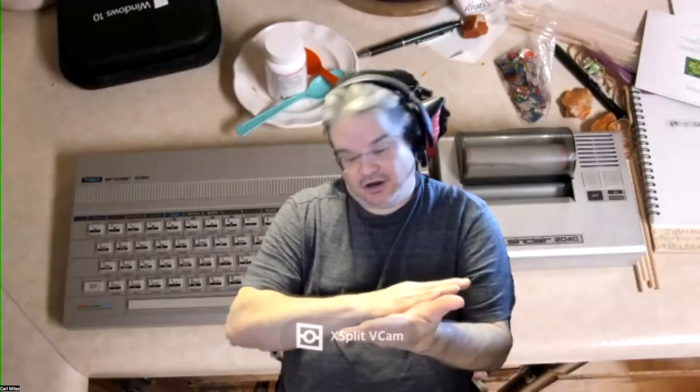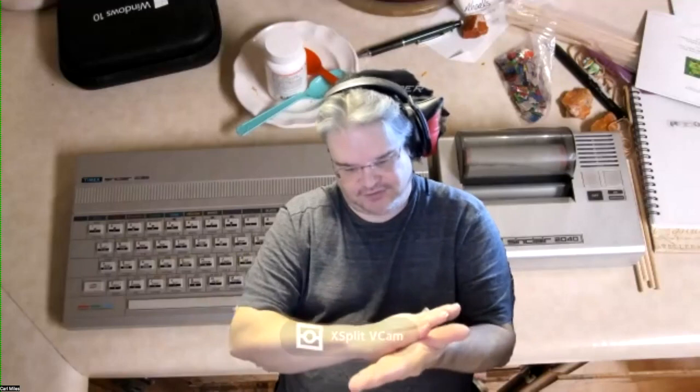Yeah. And the other thing I've seen some people do, or there was a suggestion, is that once you open the machine, you put a stiff tape, maybe like packing tape, on the whole tail, right? Because really what happens is when you flex it, that's when it breaks. The straight parts don't really break. So if you can put something on there that stiffens the whole tail, so that you're not flexing it, and the whole force of the flex is spread out. Right. So now you've got something that's stiff, like a piece of packing tape. It still needs to bend. It can't be rigid, because obviously when you put it in there, it needs to bend. But you can just make it stiffer than the factory.